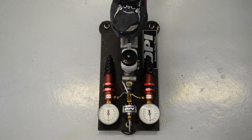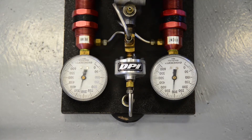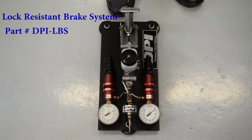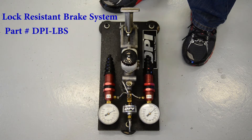I'll do it a few more times. And hopefully you can see this with the camera — it's a little hard to see, but that's a little delay that allows you to put more rear brake into the vehicle to get better braking into a turn. Or if you have a hot rod where the back end is a little bit light, you put this valve in and you will be able to increase your rear brake pressure substantially.